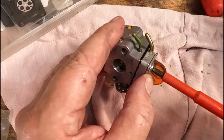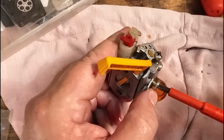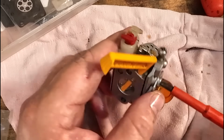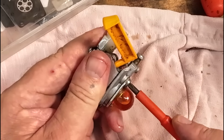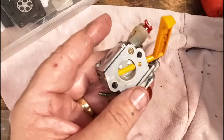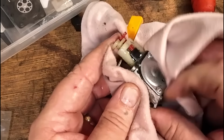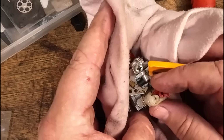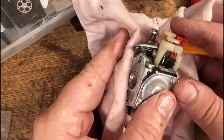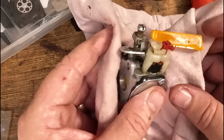And that's your carburetor serviced. It's had a new diaphragm. It's had the screen done, and it is the screen that would be the cause of the bulk of all these problems. And the reason the screen is blocked is because it had no fuel filter on the fuel hose. So we might have to tune these yet as well. I don't know if anyone's mucked with these tuners. I'm not a fan of these tuners, but that's what it is. I generally just remove those and do it manually. You can just take them off, but we'll see how we get on.